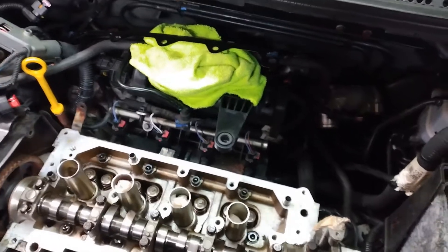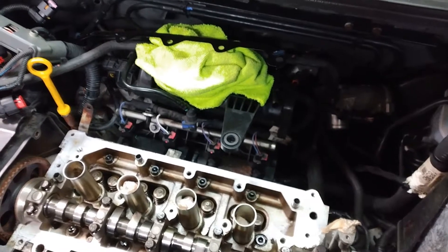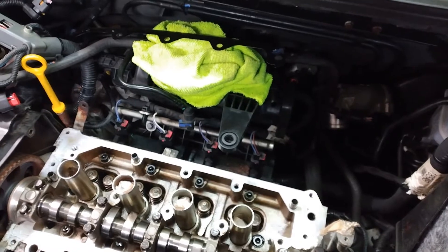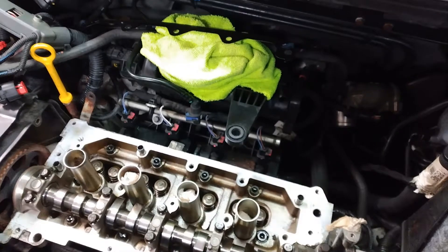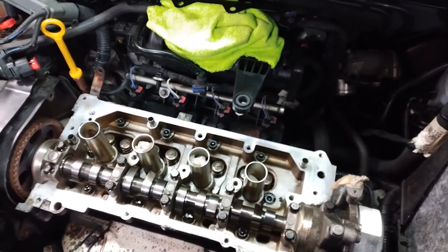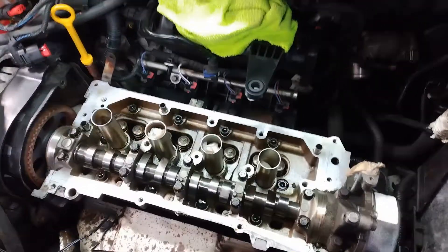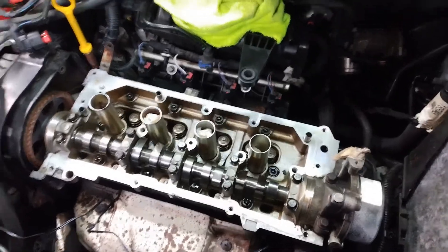You can see where the multi-air box went right along here, and those are the intake valves it operates — two for each cylinder. We did not cut the tab for the intake manifold. I had heard that if you cut that tab and bring your car in for service, they will not service anything on the engine until the intake manifold is replaced with an original solid piece. So we found a couple of special little wrenches, moved it back far enough to get the valve cover off, and by removing the top cover of the multi-air box we were able to wiggle it out.